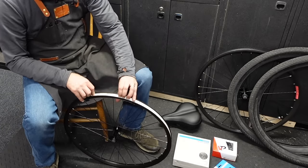If you just rough up the edges a little bit, it takes the resonance out. Eventually it'll wear off naturally. I just scratched it. It's a used bike, folks. Sometimes if you ride it around the parking lot a few times in a low gear, that helps. The front one's not howling. So we're gonna call that good and just see how it goes.